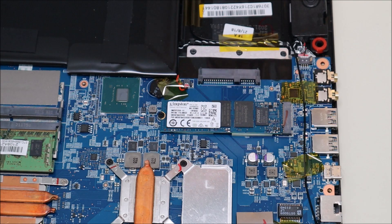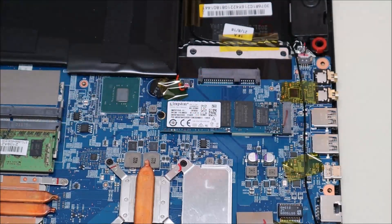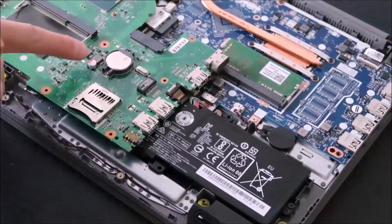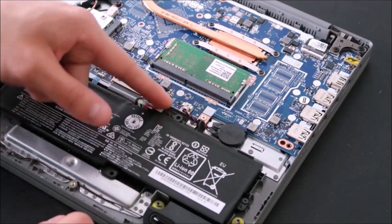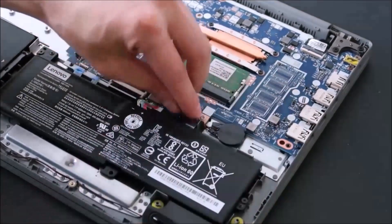If the RAM test hasn't found the issue either, we're going to look at your BIOS. Not all computers have what's called a CMOS battery, but that's the component on a motherboard that's supposed to keep power to BIOS even when your computer's off. If there's something wrong there, that could stop your computer from starting up. In this computer, there's your CMOS battery — it's small, it's black, it's wrapped in plastic, and it runs under your battery and plugs in right there. That kind of plug you would simply slide out. Another common CMOS battery presentation is on this motherboard here — all you would do is unplug it from the port. Don't pull on the wire — put your fingernails on either side and slide it out, wiggle it out, and you've unplugged it.